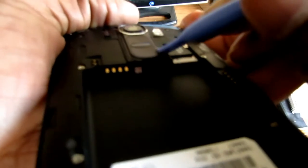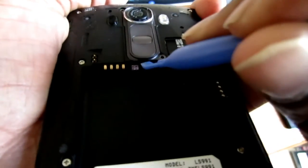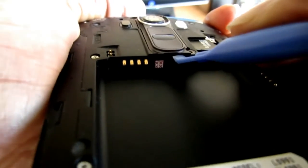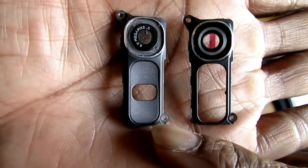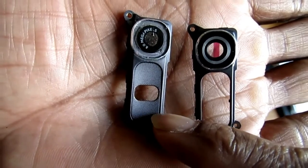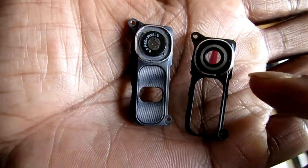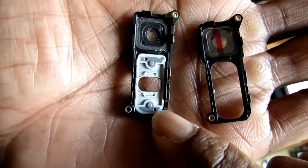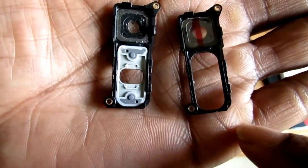Once you get the screws out, you need to pop off your little lens cover and your little volume rocker. Take this little plastic prying tool, right under here, just put it in there and it just pops on up — gently go around. Once you take it off, you see the volume rocker is still attached. But the new lens replacement looks pretty much identical, and the lens is already in there. So what you want to do is simply flip them over, pop out the volume rocker, put it in the new piece, and then attach this back into the phone.